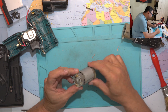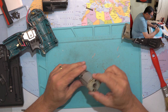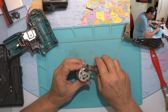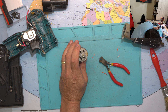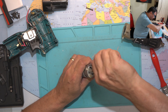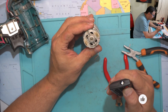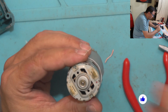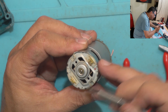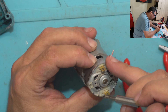What can I do here? It's probably the brushes, because this is a classical brushed motor. You see this metal here has some dents made on purpose to keep this plastic piece in place. We have to get these dents back into the vertical position to be able to extract the bottom and gain access to the brushes.